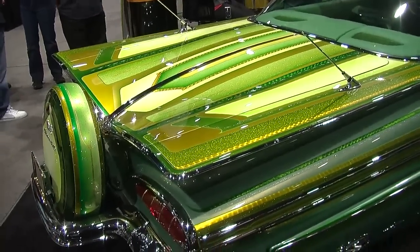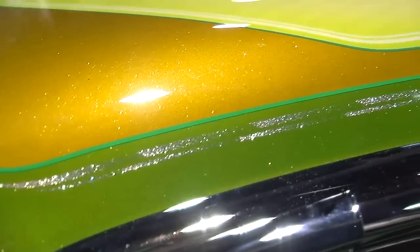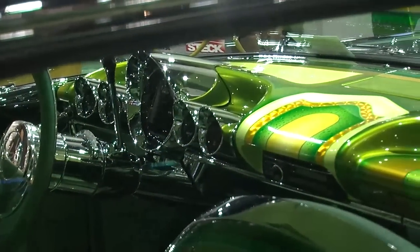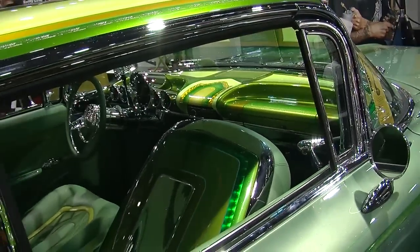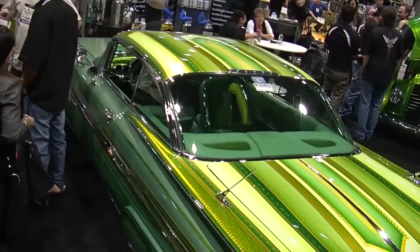On your car you painted so many different colors and what appears to be so many different layers. Were you able to leave the tape on for a long period of time? Well, the graphics were all done at one time — I just kept on it and got it done. By the time I lay it out, I'll probably leave it to the next day, so it's sitting for like 20 hours or so. When I come back to it nothing has shifted. The tape doesn't track on base coats. The glue on it is phenomenal — it's not leaving any residue behind, so there's less cleanup.